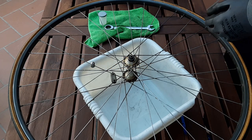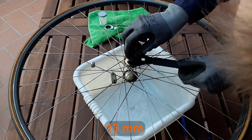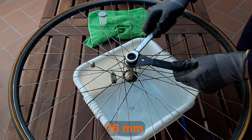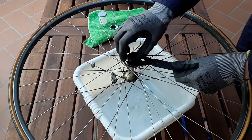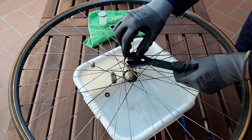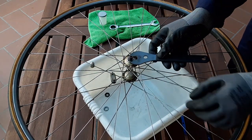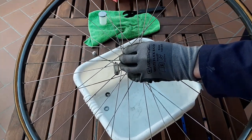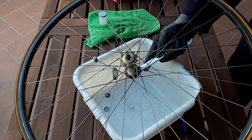I'm starting with the front wheel. First I'm going to disassemble the hub to check the condition of the bearings. I'm using a 13mm cone wrench to hold the cone in place while I undo the lock nut with a 16mm spanner. The lock nut comes undone easily. I've got the wheel sitting on a plastic tub to prevent it flopping about and to catch any loose ball bearings, but a table vise would be a good option too. After the lock nut is off there is a slotted washer. Now to unscrew the cone — I have to hold the opposite lock nut to prevent the axle from spinning while I unscrew the cone with the 13mm cone spanner.